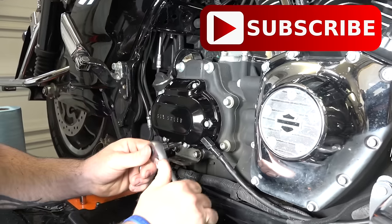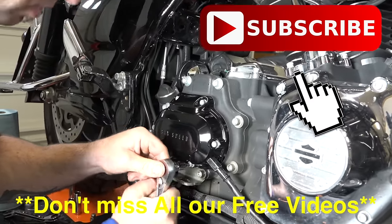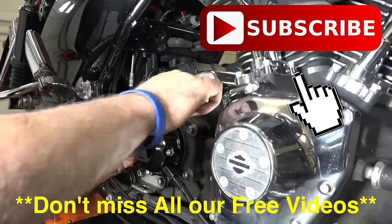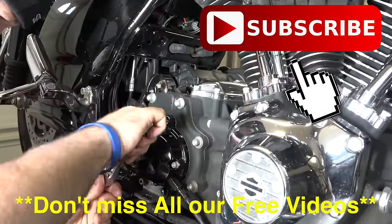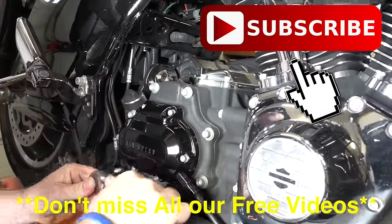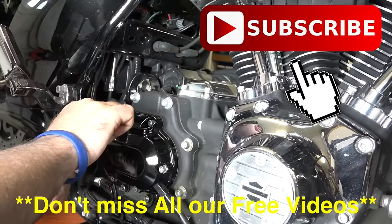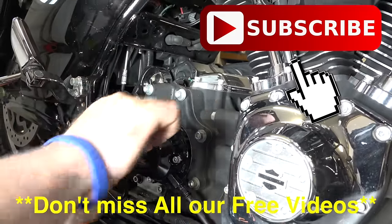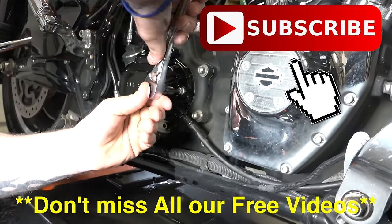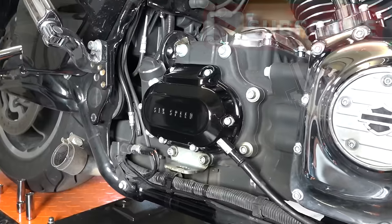All right, so he's getting all these tight. If you want to get torque specifications, go for it. We're comfortable with it. He's going to get them tight in about another quarter turn. You're seeing he's going around. You wouldn't want to just go counterclockwise or clockwise. He's actually going in a star pattern, top, then bottom, then side. Kind of do them in a sporadic order so that you get even pressure sinking that plate down. And again, don't over tighten these. You will strip them out, guys. And like we say, tighten about another quarter turn or get your torque specifications.